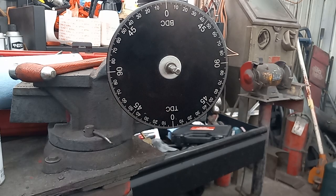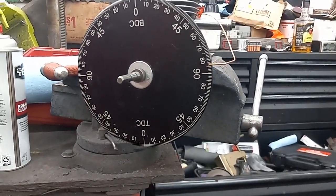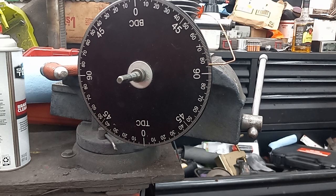I really feel using a wheel has made me a better porter, for consistency. Because if I was to fly in here blind and port this thing, I wouldn't know where it was at to start with, and where I want to push it to, if that makes any sense, guys. After you do a few hundred port jobs, you get a gauge on it, and it varies from stroke to stroke. Like a longer stroke, the amount of thousandths is going to be different for a degree versus a shorter stroke. But you'll get a feel for it. If you're shaving off 10 thousandths, you know where you're moving it to.